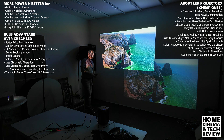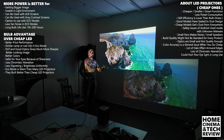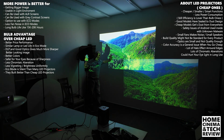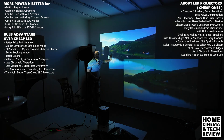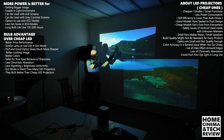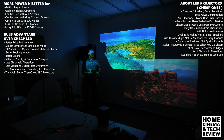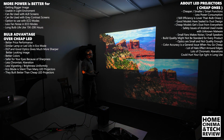One more thing about brightness: if you want to go above 100 inches, you can use this 720p projector even if it's not ideal. I can go 120 inches with this amount of light because when you increase the size you need more light — when you go big, you lose light. Think about it like a torch: if you increase the size of your torch beam, you lose light concentration. Whether your projector is short throw or ultra short throw, it doesn't matter — if you want to go big, you need more light. That could be another tutorial — how much light you need for how much size — if you ask for it in the comments section below.